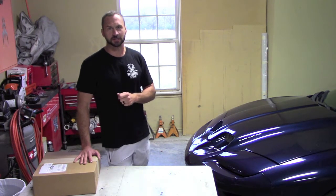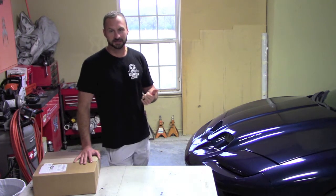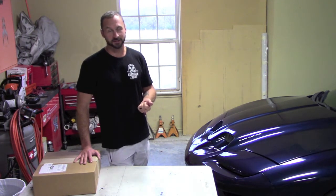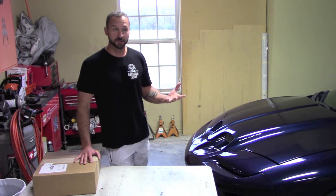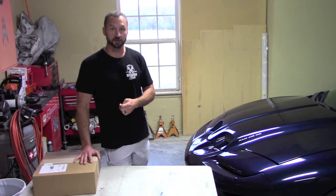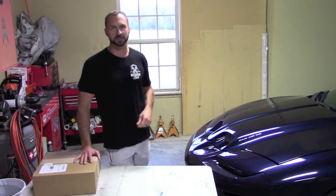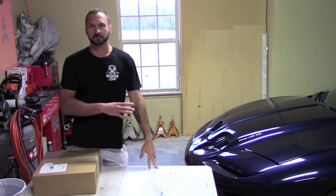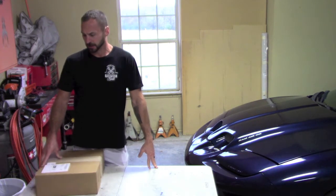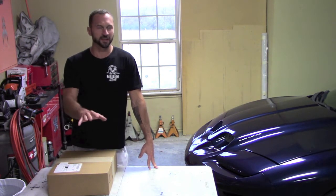Oftentimes people get a little overzealous about throttle body size. So it's not rocket surgery to calculate how many CFM your engine can consume. Now I went over this when we were choosing a carburetor for the square body build. You can see that there's a playlist on my channel. So when it comes to fuel injection engines, you'll have a little more volumetric efficiency than a carbureted engine. So let's see why that matters.